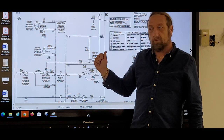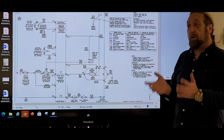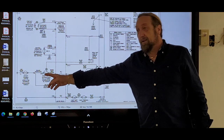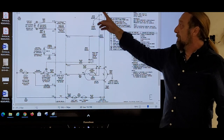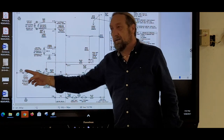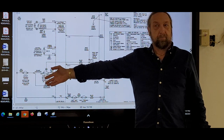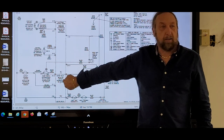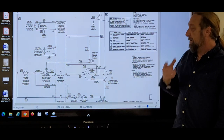Could it be testing like the same thing? No. It's not a bad test, but the problem is, like I said, you don't know whether your problem's on this side of the circuit or that side of the circuit. So by putting 1 meter lead here, going back to neutral, and I put my other meter lead here, I know that my problem's on this side, and the only thing there is the door switch. Okay? We don't check voltage here to test the relay. Okay? I'll go over that in a minute.